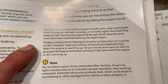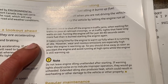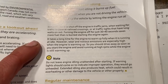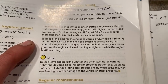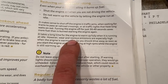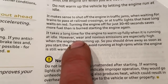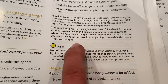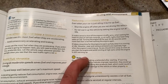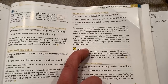However, wear and noxious emissions are especially high when the engine is warming up. So you should drive away as soon as you start the engine, and avoid running at high RPMs while the engine is still warming up. The thing I'm most worried about is wear — that's what it talks about the most. So theoretically, what do the engineers say about wear? Does it actually reduce wear to warm up the engine faster?